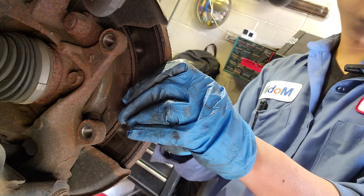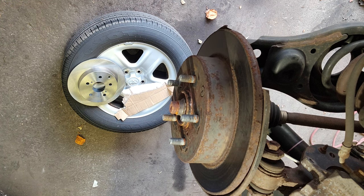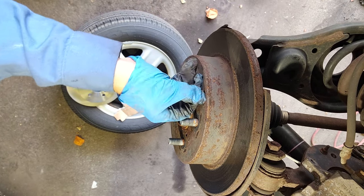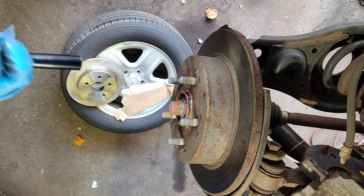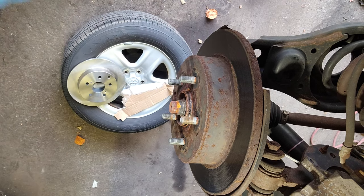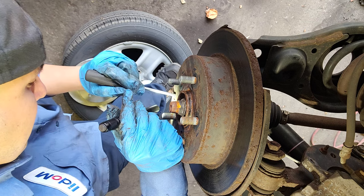Show you real quick something here. Okay, right here. There's a rubber here. I'm gonna remove that. This is just to loosen the adjuster, because sometimes the rotor is too tight. So, you have to look for the gear. Okay. And you loosen it. The other way.